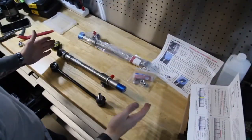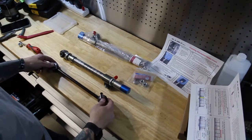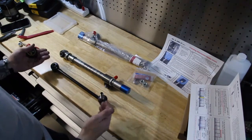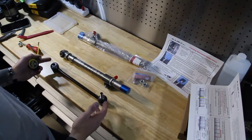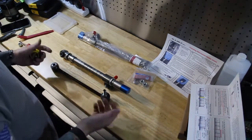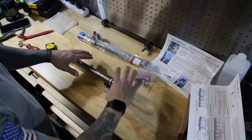We have the Apex AutoLynx unpackaged. This is a longer Terraflex end link that came with my 3.5-inch lift. It doesn't have a quick disconnect capability to it. Now, Terraflex makes a quick disconnect kit, and that quick disconnect kit is an 8.5-inch end link center to center. This one right here is 11.5 center to center. And that's going to be a little bit too long for what we need it for. Again, that's allowing for more articulation. We don't really need that because that's what this is for.